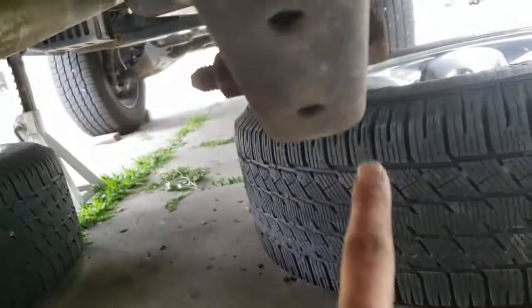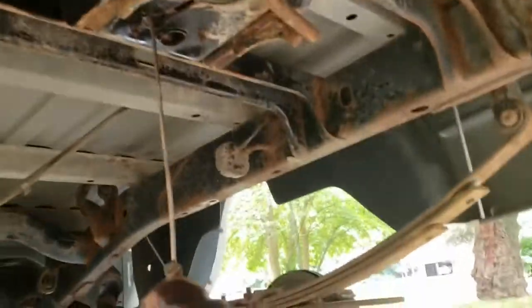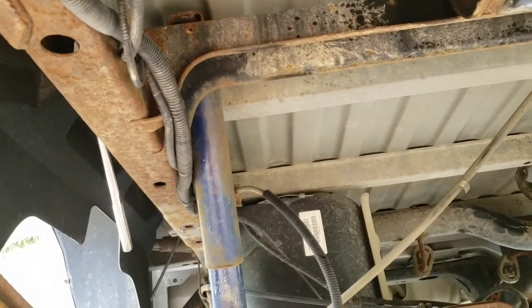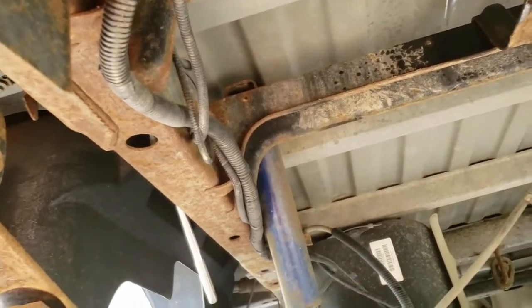Next we're working on the shocks. These are a 21mm, just two mounting spots for each one — one down here, one up there. We had a quick little hiccup for this rear shock. You could probably figure out a wrench combination but I just dropped the spare tire. Same thing as on the passenger side, just mount down there and mount up there. Just be careful because there are some tabs up there and mine were all seized up so they flung around when I hit it with the impact.